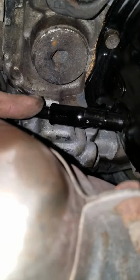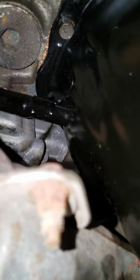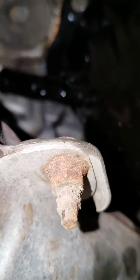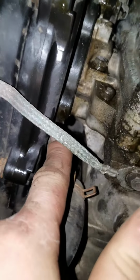it in here. Make sure you have some new O-rings and you oil this up real well before you put it in. This part, if it doesn't actually line up because it's an aftermarket pan or something, you are okay to hit it with a rubber hammer to bend it the way you want, up, down. Well, basically up mostly, but yeah, the oil dipstick tube is nice to have free. It goes through the hose from the oil pan up through the middle there, up to that bolt that I told you about removing up top.